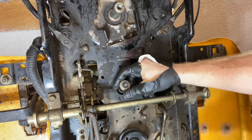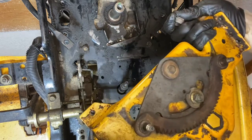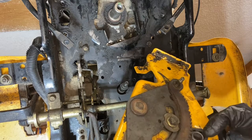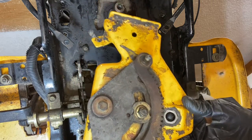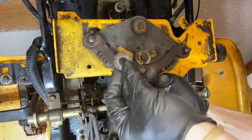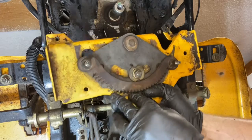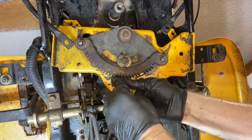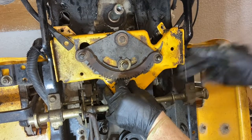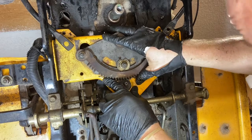Since we last left and I whacked myself in the head, I've come up with a new method of installing this plate — I've installed it about six times, cursed, ripped my gloves, and lost bolts. New method: install the washer and bushing first so it's flush. When you push it up, you have to push it up with the washer already on there — once you install it over the steering shaft, there's no room for the washer. It won't fit over the sector gear. You've got to install it all as one piece. Just take your time, breathe, and be patient.